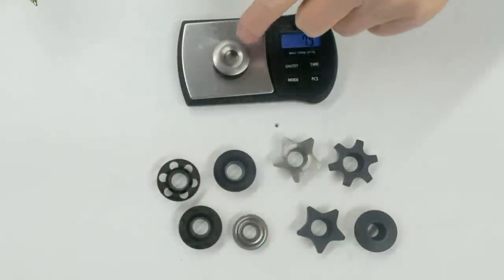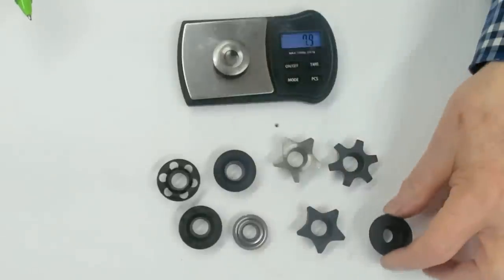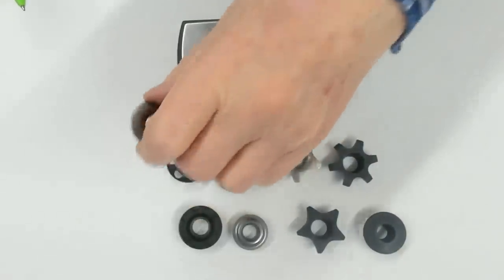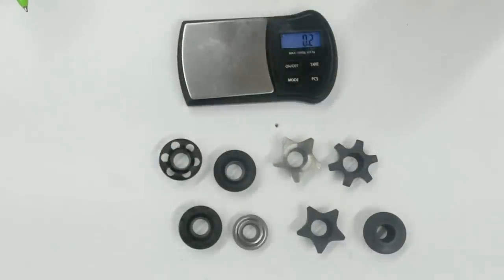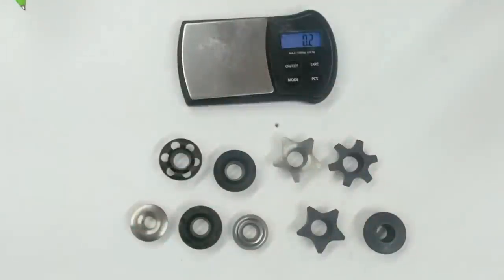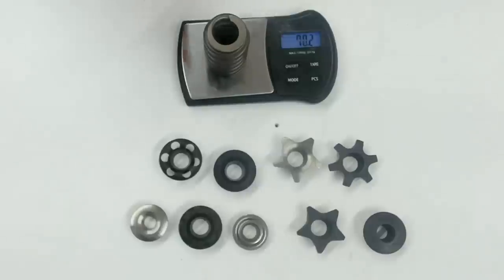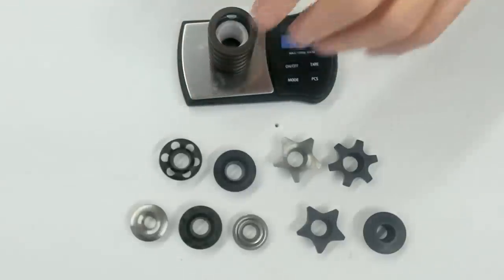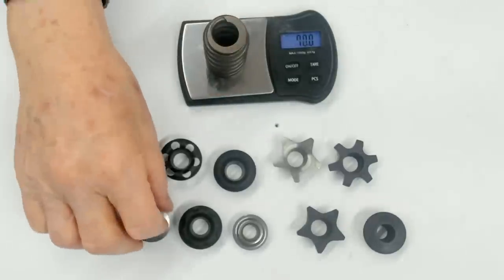7.9 for a beehive. Now this one is as strong as this original steel one. No lightening done on it. You'll notice that it's almost as light as this aluminum one here, which will not stand a lot of abuse and would only be able to make a few passes of the drag strip. Right, so we can see the advantage here of using the beehive spring, because not only do we have a super light spring, but compare it with that, right? But also we get to use it with a super light retainer.